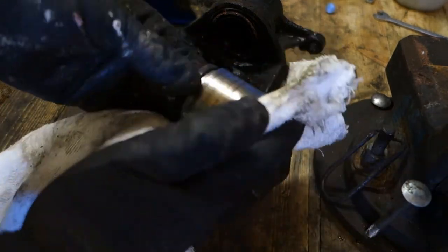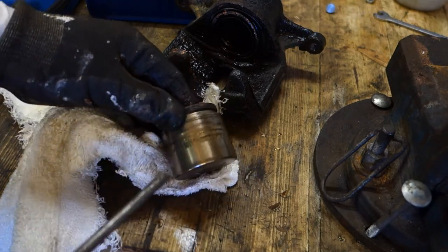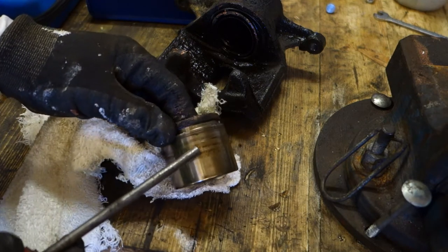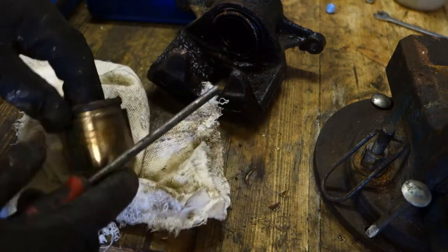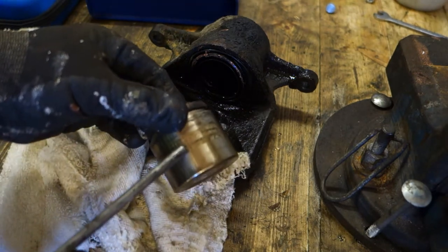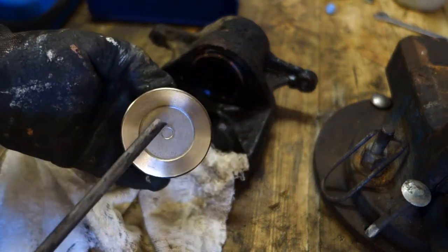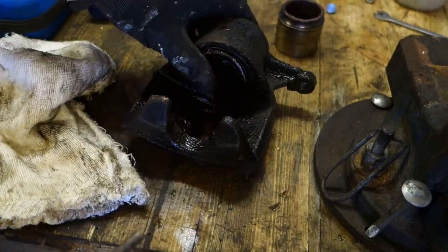And now when I clean this brake caliper piston, I can right away notice that these areas that are black when I use my screwdriver, these are bad areas. These black things generate friction, and they act like a brake, stopping things, because this piston should move very easily inside this cylinder tube in here. And now when there is this black dirt, this is bad. I need to clean these things. I need to polish my piston, and it must be as shiny as this area in here. These are bad things.